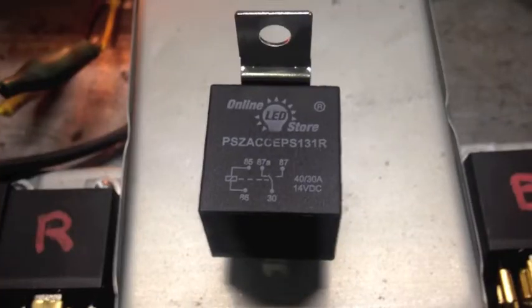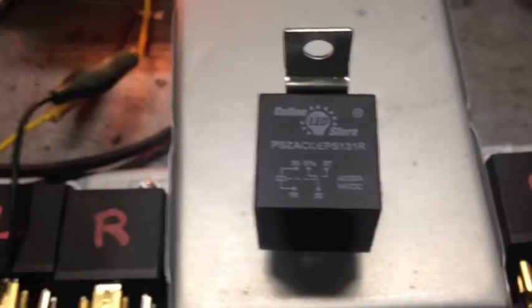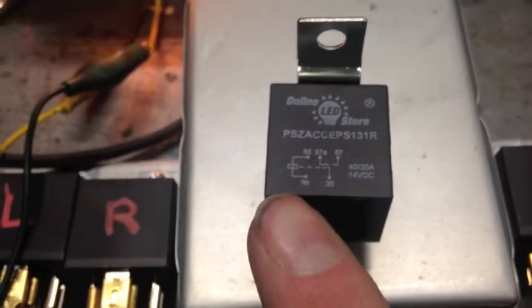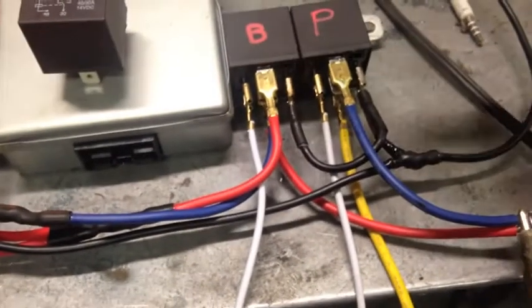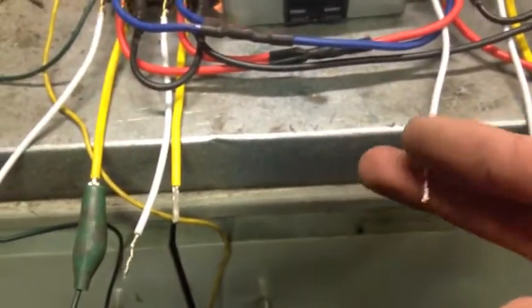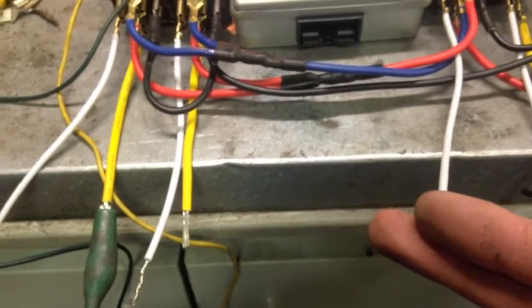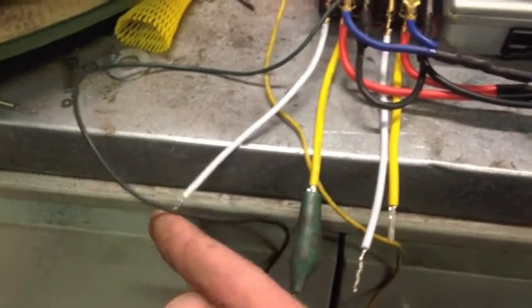Alright, so inside of these relays, we've got these 5 pins here. Those 2 are the coil. I've got a ground. Well, it's going to be a switched ground, so I don't have to listen to these things when I don't have a trailer hooked up, but I've got a ground going to all of those. And then I've got individual white wires coming off, and those are signal. So these are going to be hooking in to what used to run into the converter box from the truck.